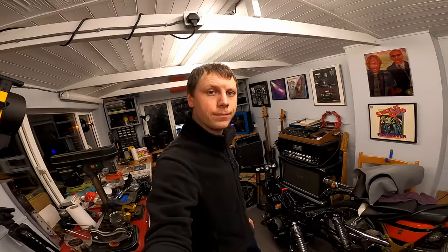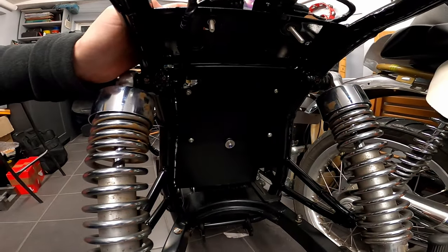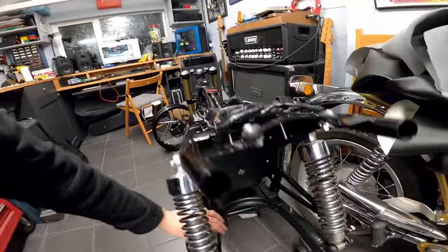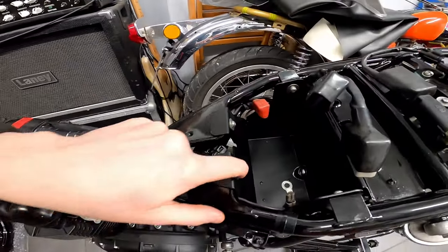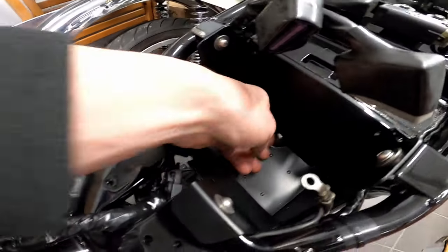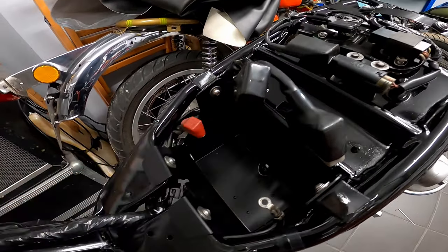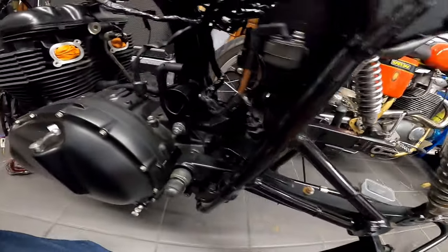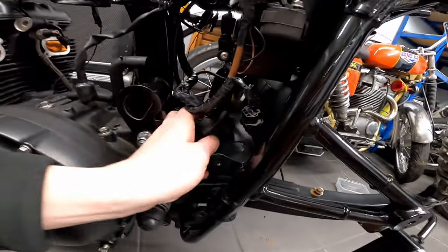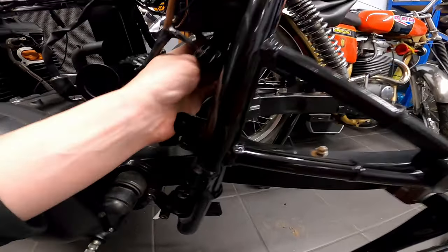It really is that simple. There are four fixings in the back to mount the liner tray to the battery tray. You can see the lower fixing for the mudguard, and then there are four M6 fixings that mount the battery box. There's a button-head fixing down there for the mudguard which will be clear of the battery. The battery will sit about here, then the ECU drops in, so it should all be good. The starter solenoid, fuse box, and air temperature sensor are all sorted.